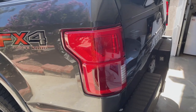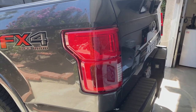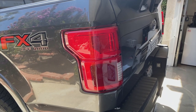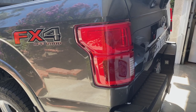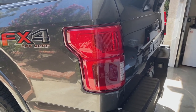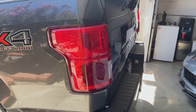I showed you before I had a bed rug. But I was on the F-150 forums — I think it's F150forums.com — and there's a guy on there named Boosted Gray Goose, 2016, I think his username is, and he hooked me up with these OEM LED BLIS taillights. Someday, if I really choose to do so, I could add BLIS with a wire harness, some programming using Forscan, new mirror glass, and harnesses leading from the front to the rear. I'll probably never do it, but it's still a possibility, because he said the BLIS modules are in these taillights.